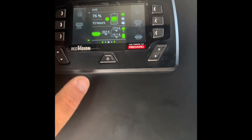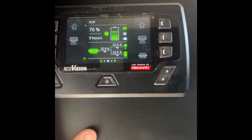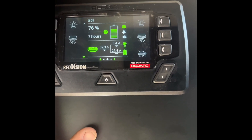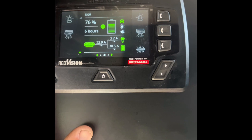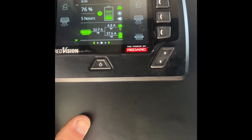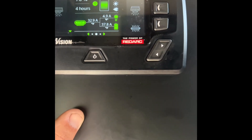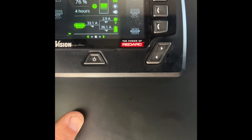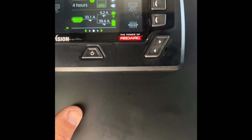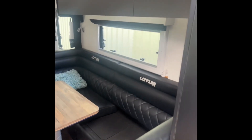Back to the caravan — the Manager 30. So now we've got the Manager 30 going plus the BC DC 50. Aircon's running and we're still putting in 30 amps, so that's a huge gain. Aircon running, solar running, car running, and we're putting plus 30 into the batteries with the AC running. Pretty amazing feat, but it is possible.